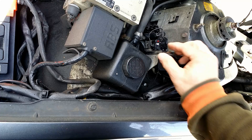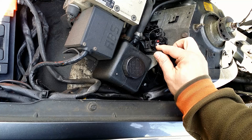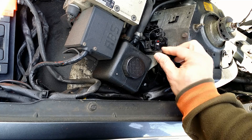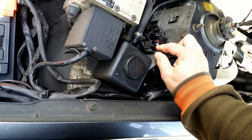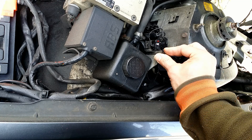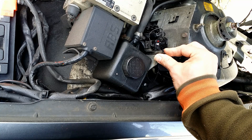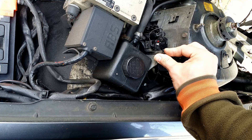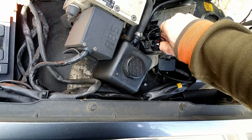Let's fix this problem, and now we will need to clear the code. I press the button for more than 5 seconds and let go. The LED turns off and then back on. While it is on, I press it once again for more than 5 seconds and let go. Let's check the codes now — the blinks read 1-1-1, which means no problems. Everything is OK. The memory is cleared now.